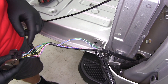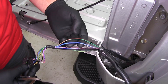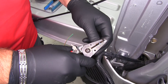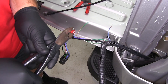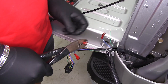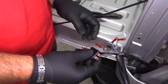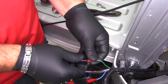I stripped the wires back a little farther from the plug to give myself more room for the diodes. Go ahead and cut both wires and strip back the ends. Add one of the spade connectors onto each one, then do the same with the green wire. Take your diode — it has two ends, in and out. Out goes to the taillight, in comes from the wiring. Plug your blue wire into one side and connect the other.